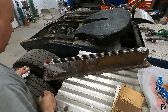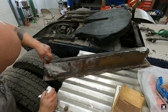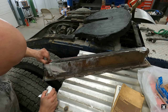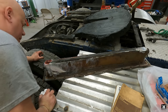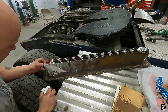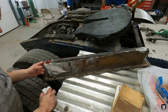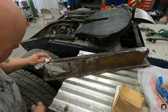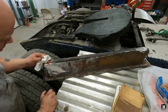Now the heat exchanger's upside down. And I'm trying to... that's leftover coolant. That's gotta be crunchy coolant. I'm looking to see if it's originating from a bad O-ring, but it looks like it's coming out of that piece there. I'm willing to bet you this heat exchanger's shot. This is crunchy parts of coolant.